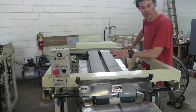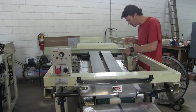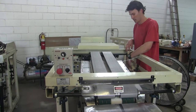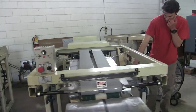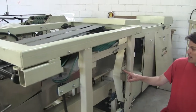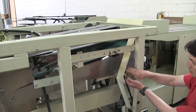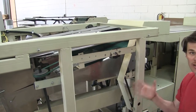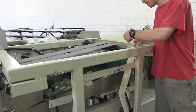I know I explained it wrong on the phone call we had this morning. But what we're going to do is take this chain guard off. I'm going to loosen this chain tensioner right here — all I've got to do is there's one bolt right in here. Just loosen that up and you can move this out of the way and it'll cause this chain to completely loosen. That way I can come up top here.